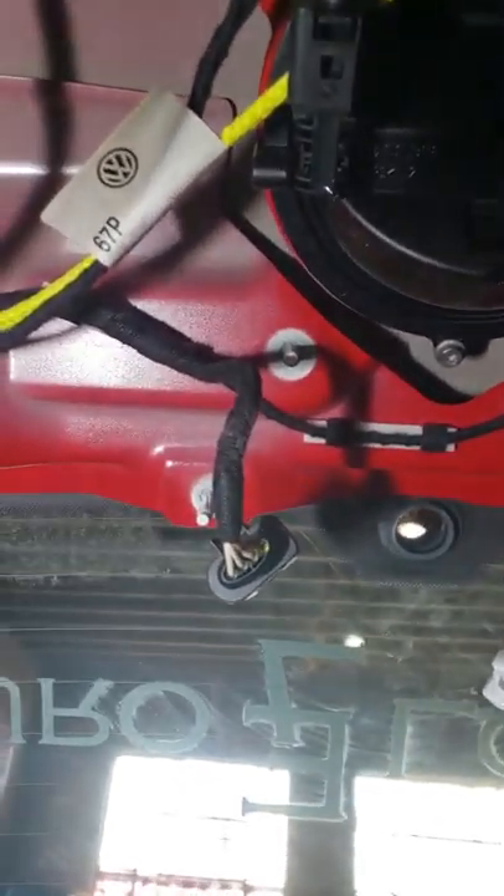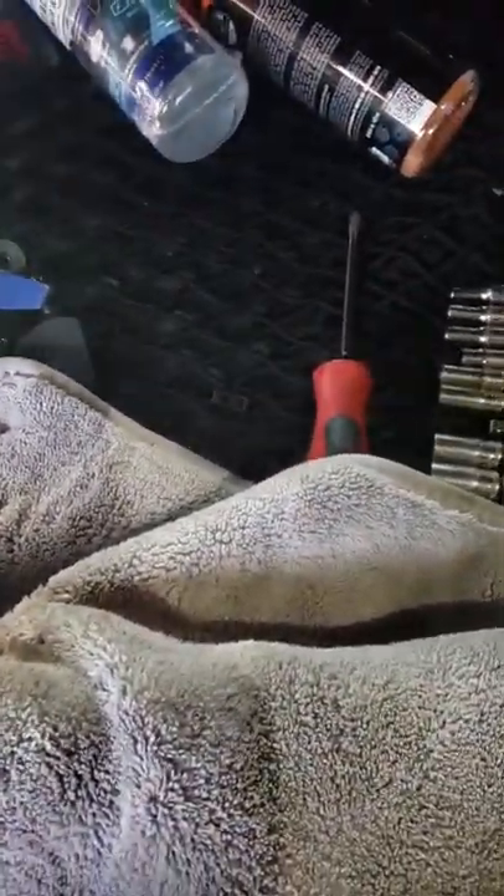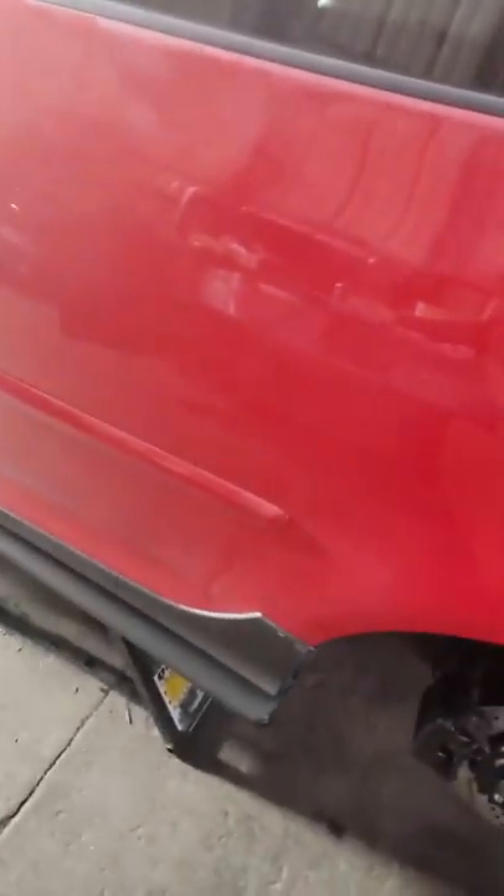And that's what you're left with. What I'm going to do is zip tie these wires — maybe back on itself or just tuck it in like that. Zip tie that up there and do the same with this one here, just to keep them secure. After you pop that panel down, the wiper motor is now out. The delete is pretty simple — besides getting to this point, just be careful not to break anything. Let me find the wiper delete so I can finish the job.